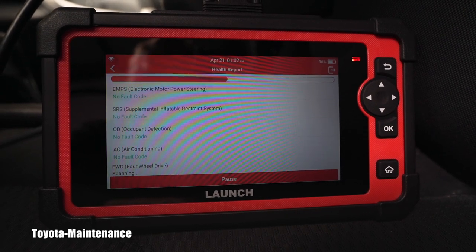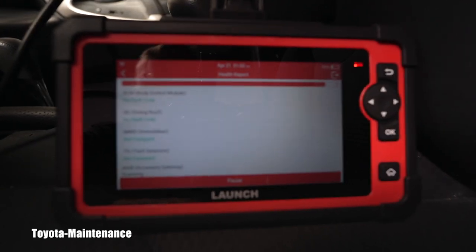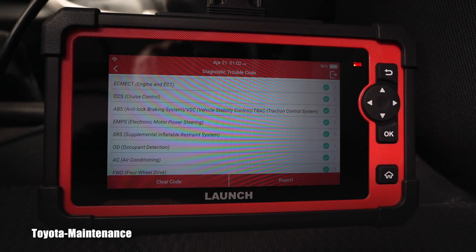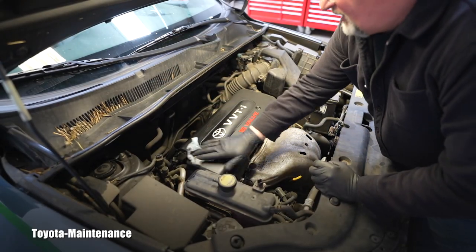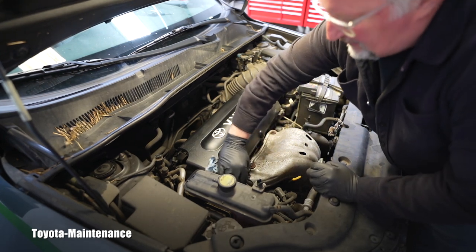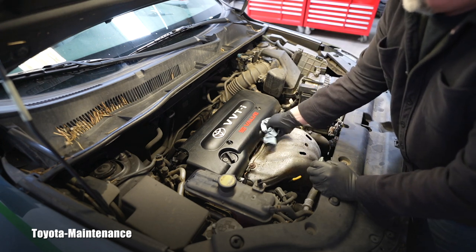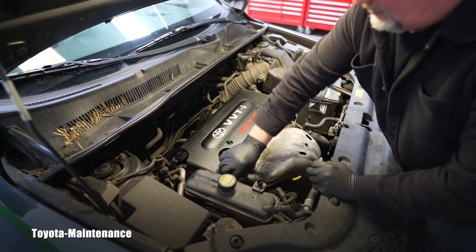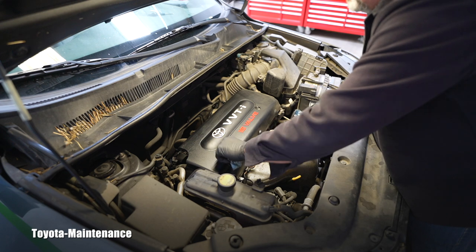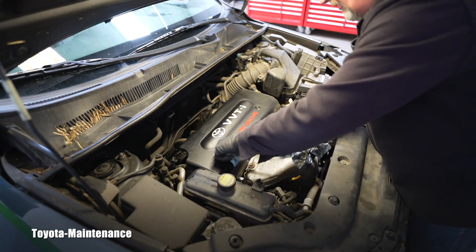After rescanning while running, there is no misfire in the ECM — all stored, the fault is not current. There might be a fault coming if I start driving and the electronic steering detects a problem, but right now everything is clean. If you want to be good at this profession, ask a lot of questions. In this case the owner immediately told me: she forgot the oil cap, started driving, realized it wasn't closed, found it, put it back, added oil, kept driving — and that's when the codes came on.